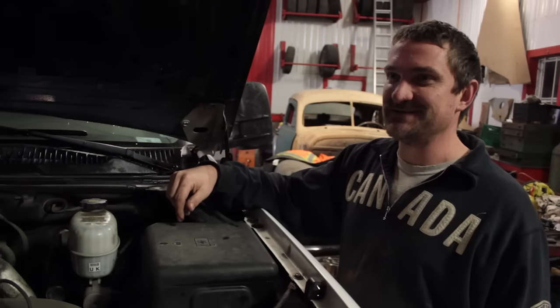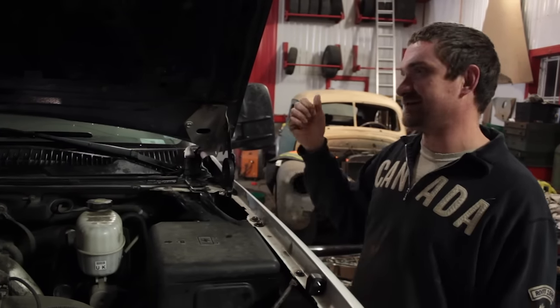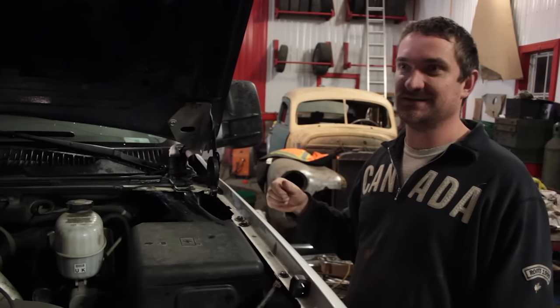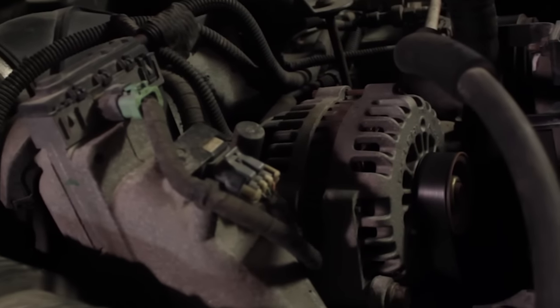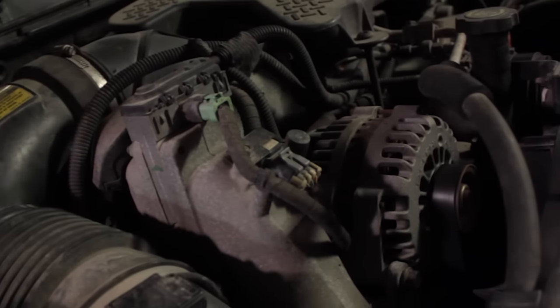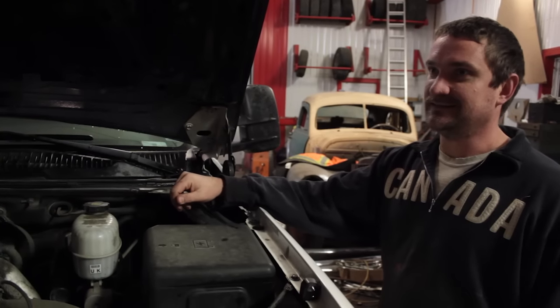Simple stuff once you've done it a few times. The first time you kind of run around. There's also the glow plug light, which isn't wired in a gas truck. And being this an 06 motor, it's CAN bus — so that wiring's not in the truck, being an 03 body. So you have to run all that.